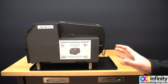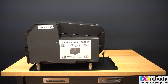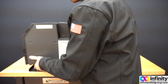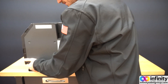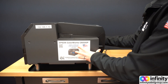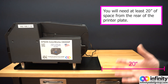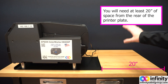Don't assume your printer is in position — if there's any movement, that means it's not in the right place yet. You may have to adjust and move it around so that those four tabs fall into the handle slots under the printer. You'll know when it's in position because you really won't be able to move it. Make sure to give yourself ample room behind the printer because, unlike other unwinder and rewinder setups for the ColorWorks printers, both the unwinder and rewinder are going to sit behind the printer.